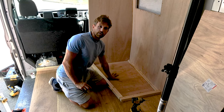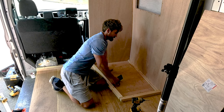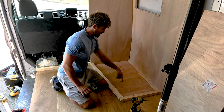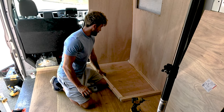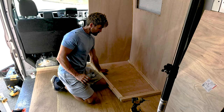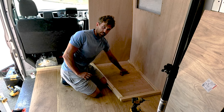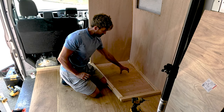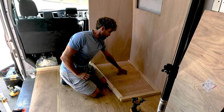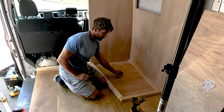At the moment I've got an 18mm base here and I'm going to be putting 12mm on top. This is the highest point of the shower tray, which will be the same height all the way around. Then I'll decide whereabouts to drill the hole for the waste of the shower, and obviously that will be the lowest point for the shower tray. So once I've marked out that point and cut the hole, I'll create battens with a gradient from this height coming down to the waste itself.